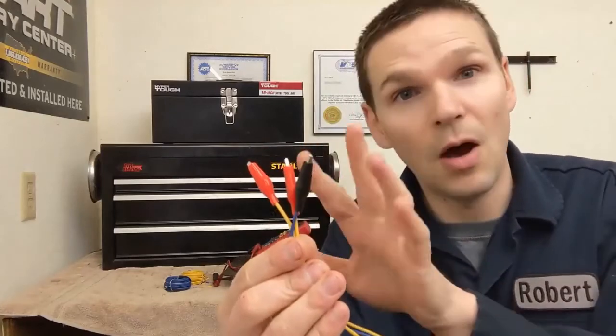A variable resistor like this can pretty much work with most temperature sensors — whether it's the intake air temp sensor, the ambient air temp sensor, or the coolant temp sensor. Some vehicles use a thermistor inside the evaporator core for the AC to know when to turn the compressor on and off. This can be substituted there as well. I also used it for a fuel gauge, which is just a two-wire variable resistance. Sometimes position sensors can be used too, and for those you'll need all three wires. Not all position sensors operate the same, so it just depends on the circuit.